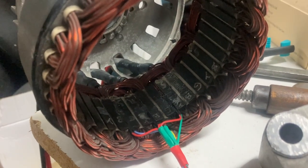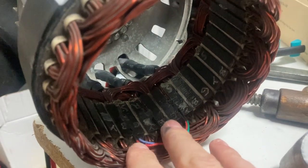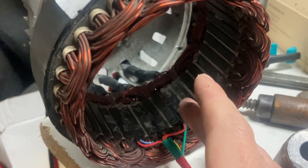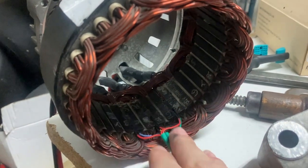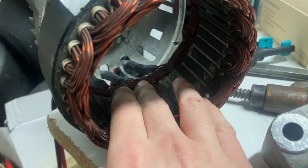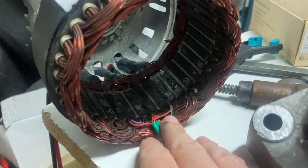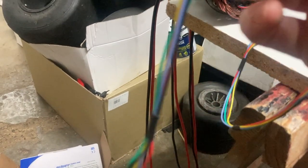I had a hard time mounting the sensors, but they are spaced the same way as my other video because it has the same poles and same coils. I routed the wires to the front because the insulation remnants at the back were a pain to remove, so I routed through the front and crimped the connector.